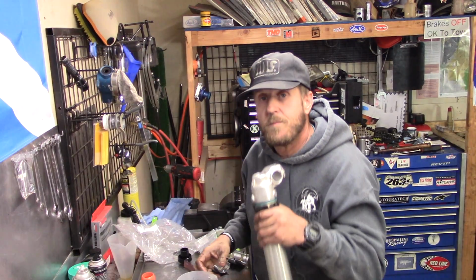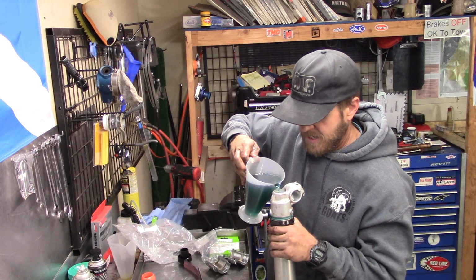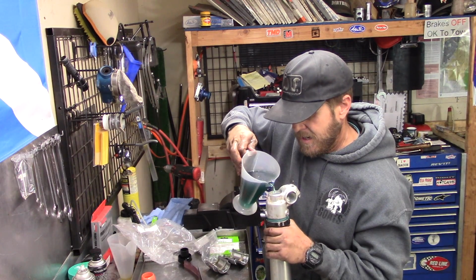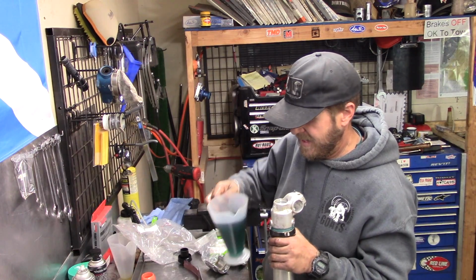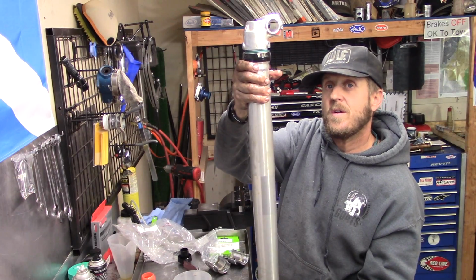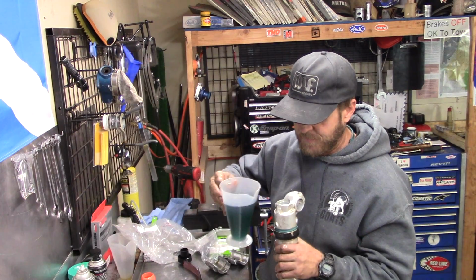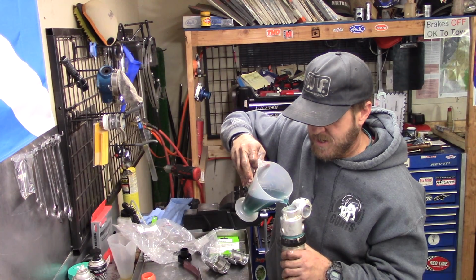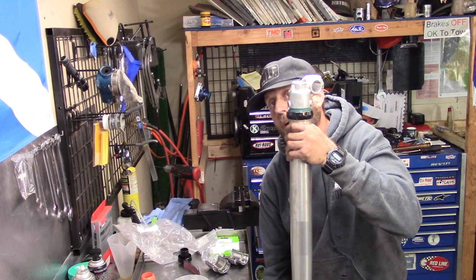There we go. All right, so now I'm going to pour in, and you pour slowly. And like I said, it's weird, because normally you'd think this would be running out on the floor, but it's not. So you go in here like this, and then you're going to take this and you're going to pump it. And you can hear it gurgling and bleeding down. So we're filling up the cartridge from the bottom, which is kind of backwards for most forks. I'm going to pump that.